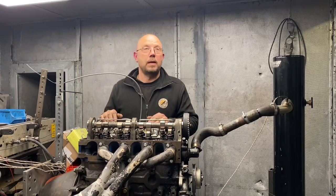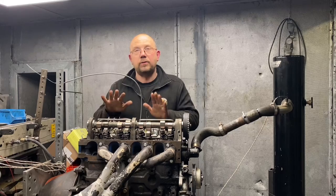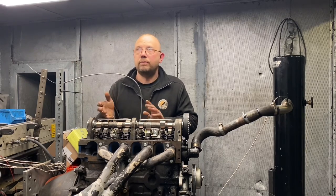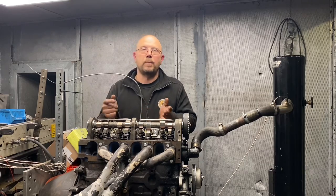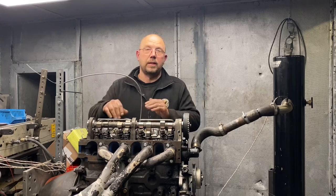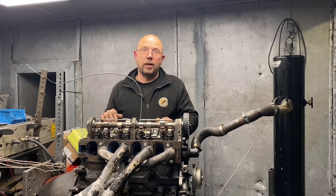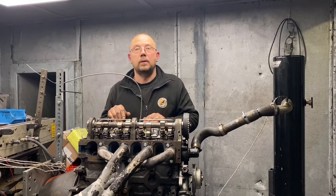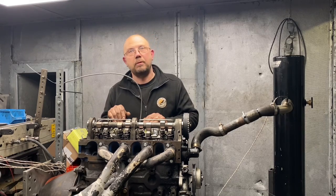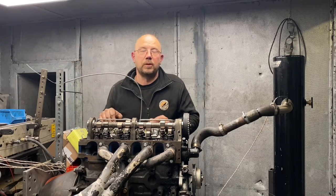We're going to do this for a couple of reasons — one, it's interesting to see. Even on a completely standard engine I found a pair of 45mm carbs will give four, maybe five horsepower more than the 40s, and obviously with this engine with the upgraded head and cam the power difference should be bigger. It would be interesting to see what the difference is and then Ross could decide whether he really wants to spend a thousand pounds to upgrade to bigger carburetors or stick with the 40mm ones he's currently got.